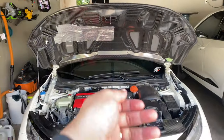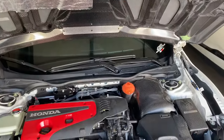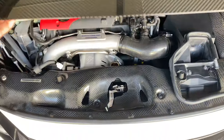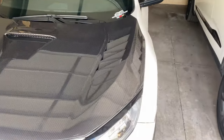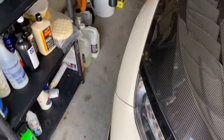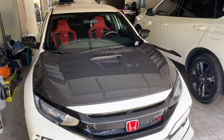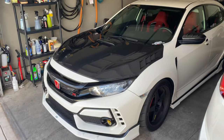I had to adjust this one notch up so I can close my hood — just dropping it from about 12 inches. One thing I do not want to do is ever push down on the hood. You just drop it. I know that's kind of scary, but that's probably the safest way to close it. If you're worried about fitment, don't be — this thing fits perfect. You just have to make minor adjustments. Appreciate you guys watching — give it a like, share it. It's one of the first videos of the Mugen hood and Mugen wing install. Have a good day, thank you.